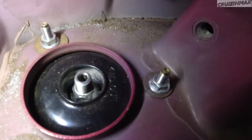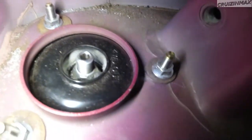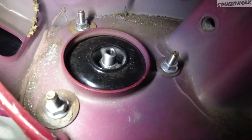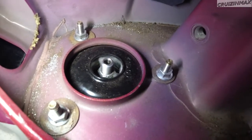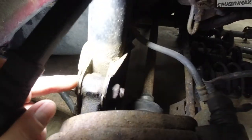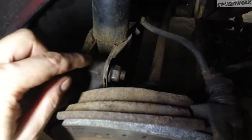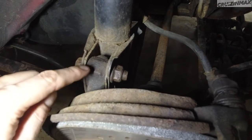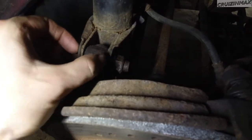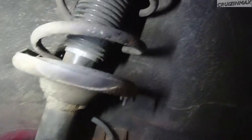I actually spent about an extra 2 minutes looking for these rusty washers, so the car kind of accepts it and doesn't think that it's foreign objects. And this is the bottom. Now I can tell you one thing, these struts are a little bit wider here. So the knuckle on the newer Imprezas is a little bit fatter, which is no biggie, and the bolt just squeezes it. No issues there. So this is it. Rear left officially done. Nice.